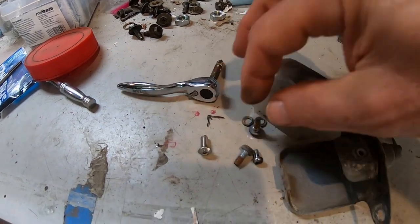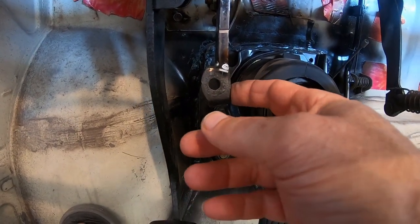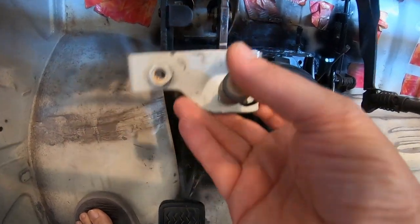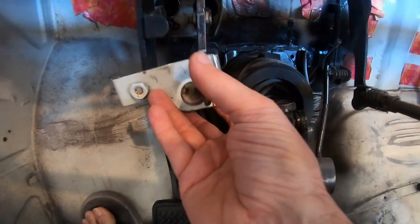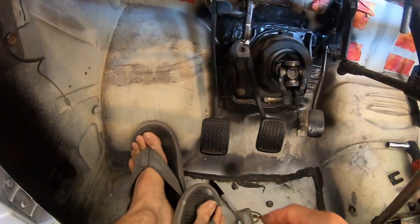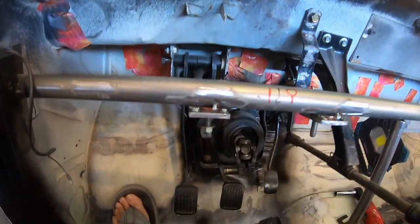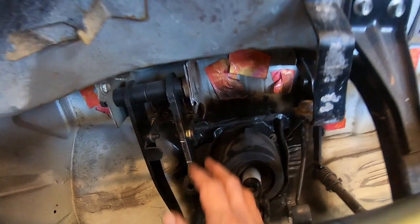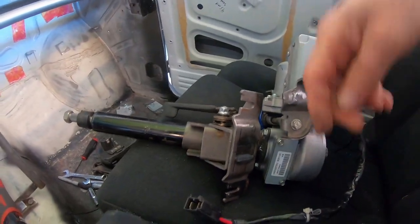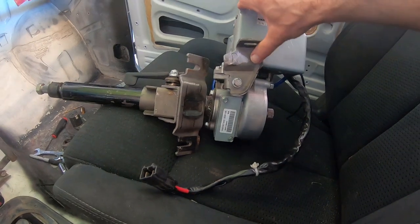I just relocated the brake light switch on the pedal — moved it from here down to here, that was pretty easy. I put the power steering motor back in where I've got some room. I'm going to run some steel from here to here. I've moved it way back and it fits really nice. All I had to do was cut that corner off. I also relocated the wiring — it was all rubbing on the brake pedal, going all the way around the unit. I just unzip tied it and it can go straight to the fuse box without getting in the way of the brake pedal. Win-win.